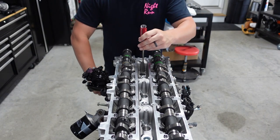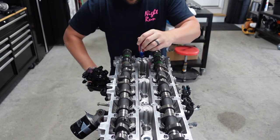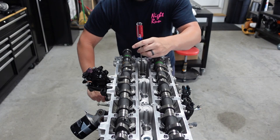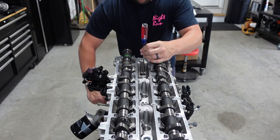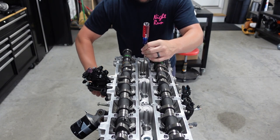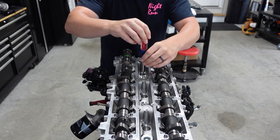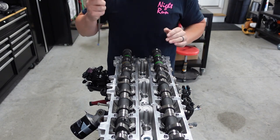I'm on the crank right now — let's keep spinning. Now it is going down. See, it went back up — so gently go up. I can see right now it's at TDC. I'm going to spin a little bit more and let it start coming back down. There we go — now it's past TDC, brought it back down from that, and that protects us from messing up the valves.